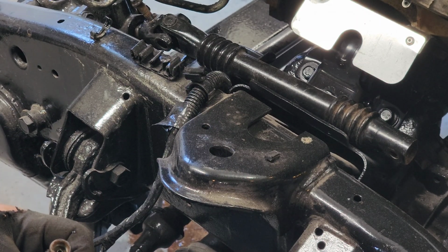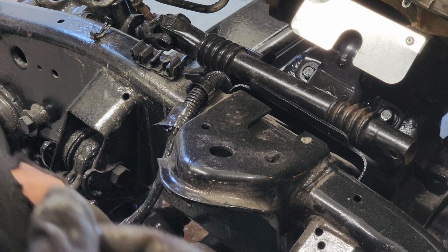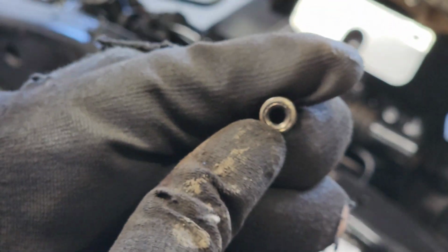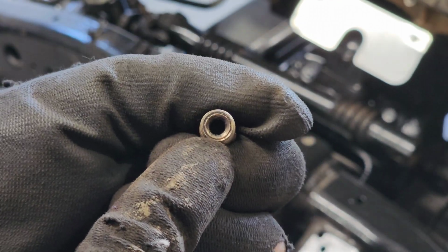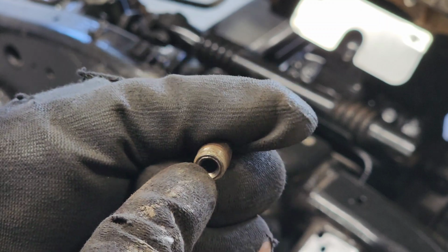Looks pretty good. This inside here's got some stuff actually that desperately needs to be cleaned out, but I can get that out of there. And you can see why that copper line, everybody likes it, because man, it really does come down over the cone. There we go. Sorry, not even looking at the camera. It comes down over the cone really, really well and helps seal up a bad flare or a lackluster flare.